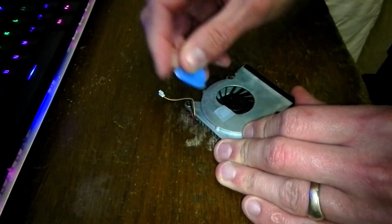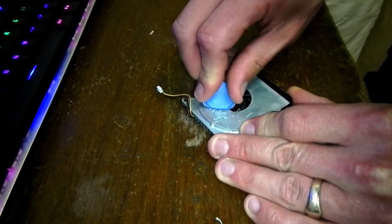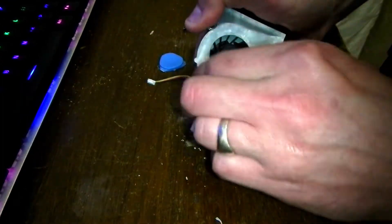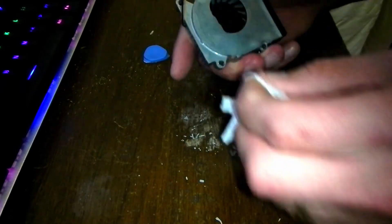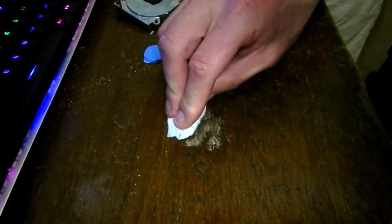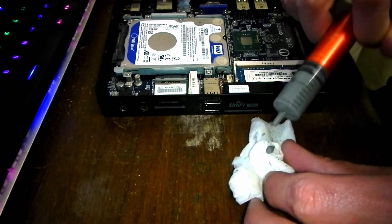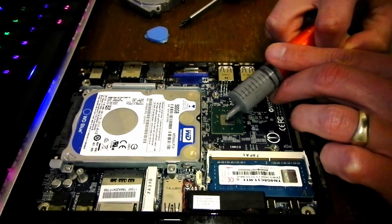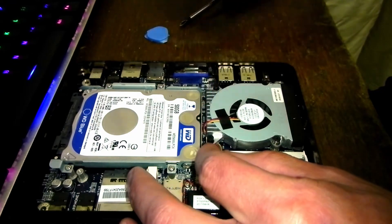This was a very difficult piece of heat paste to remove. I'm pretty sure these heat pads, when they leave the factory, are designed to become this hardened. But yeah, it's not for me - I'll just put on fresh heat paste for whatever worth it is. I always squirt out the first bit, because this is not the most expensive heat paste, and the first bit tends to be just more oily than containing any actual heat conductive material. But that should do the job nicely, and back on our little cooler goes. Now, cleaned and lubed.